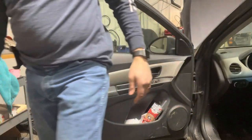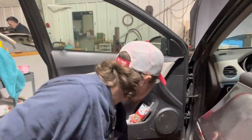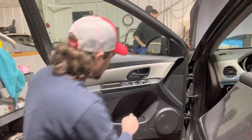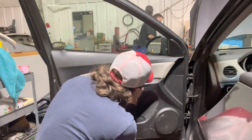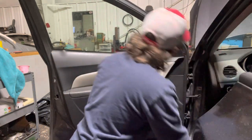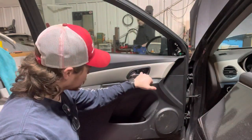We've got to pull them off and check the plug before we can go get new ones. We're going to need some pry tools. Behind the door handle, a piece of trim plastic comes off. There's a Torx screw in here and behind this rubber cover we've got another Torx. Those appear to be our only two fasteners — Torx here and Torx here.